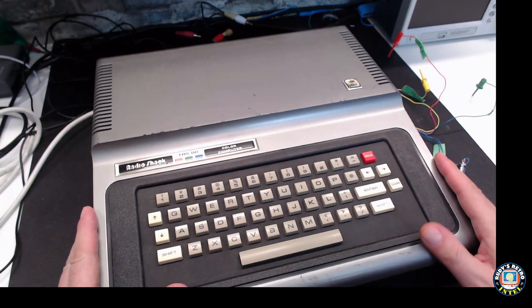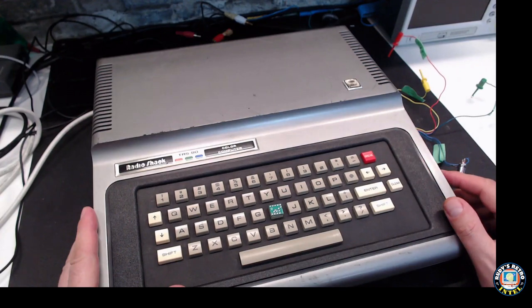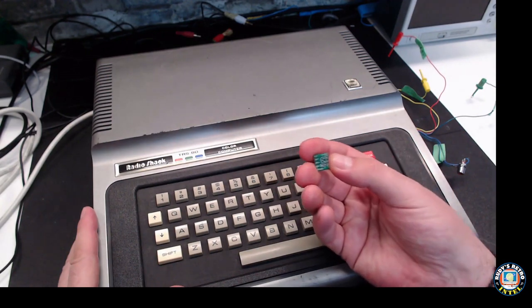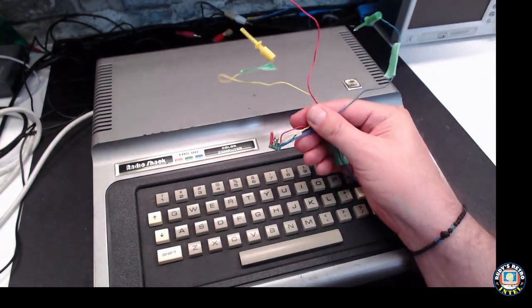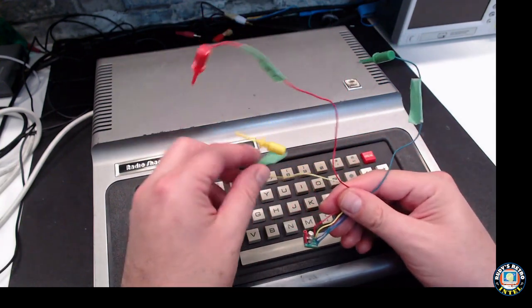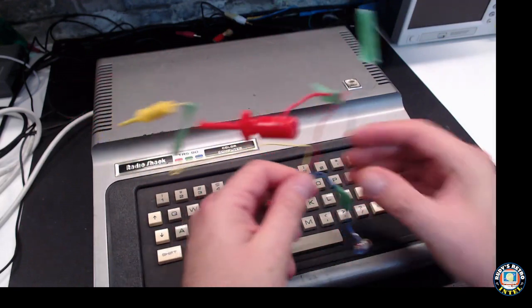Here's the CoCo 1 and where we'll be doing the composite mod, like I mentioned, with this tiny little device called the Tiny Comp. It's available at Joe's Computer Museum at jcm-1.com — I'll put the links in the description. This board is very tiny and I built one here for myself for testing. When I have new computers that I've never put a composite mod on, I use this. The inputs are labeled: video in, plus 5, ground, and video out.